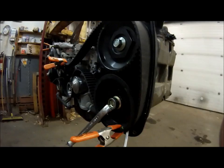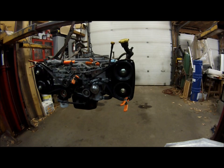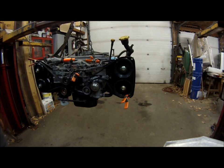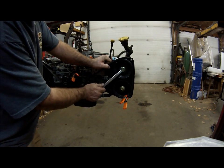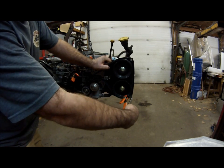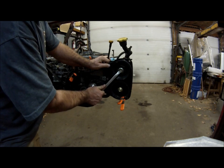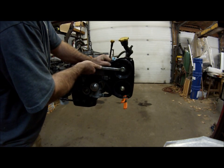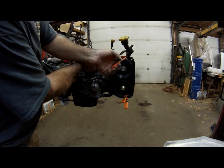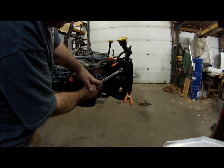We'll go across using one of the clamps to keep it on the crank, coming around and clamping it so your one notch lines up with the pulley. On the left side the cams are loaded — they have spring tension pushing the valves open. I like to take the bottom one, line it up with the mark on the outside, clamp it in place, and then using the intake cam bring it all the way back until your mark lines up with the mark on the belt.